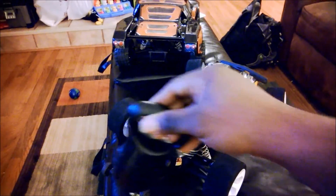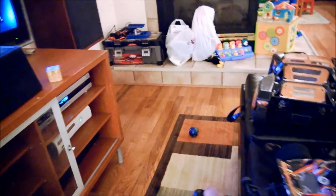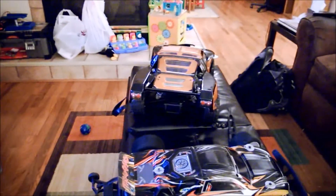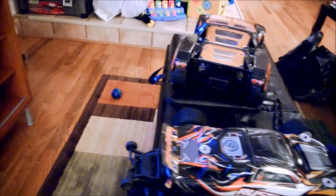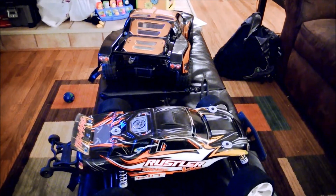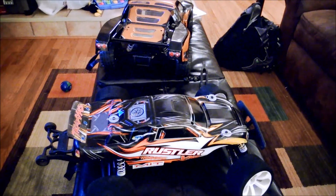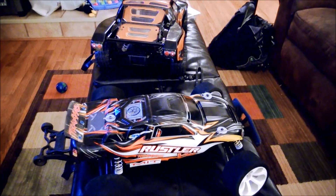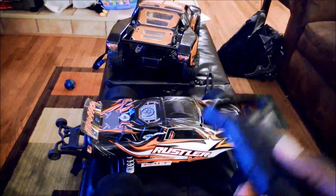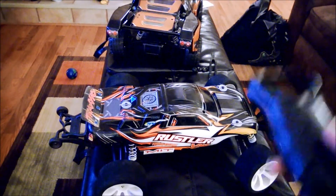How much weight do I have? That's easy — the fish scale again. I take the measurement at each axle, or more precisely at each corner, add those together and that should be the total vehicle weight. I compare that to the vehicle weight when I just measure it whole, like weighing a fish, and all the numbers should check out. Since I have two vehicles, I'll reproduce everything with the new car as well. That gives me a real-world measurement of how much power I can put to the ground, which lets me go back and check my aerodynamic models to see what speed produces drag equivalent to the power I'm able to put to the ground — that determines the top speed.